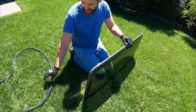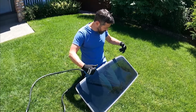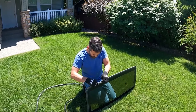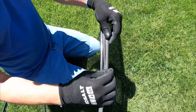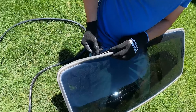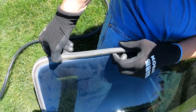There's a puffy outside edge, so when you're trying to figure out which way this goes on - there's a flat side that's hard and rigid, and then there's a puffy edge, and that will go on the outside. This little lip right here has to go in this channel right there. Then there's a lip that pops out here - that's the hard part. This edge has to go down in there, and then this trim goes over this lip. That's what gives us this flat edge. If you don't get a flat edge right here, you'll know you've got a problem.